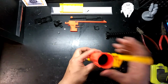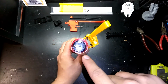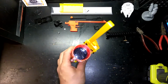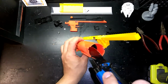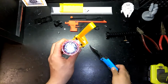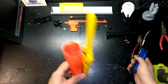Now you can see the back plate there. Hold on, let me get the lights on again. See that back plate there, and that is the air restrictor. You can see the 3 prongs that I had. Now, what I did before getting any kind of Dremel or cutting it out is I would take a knife and quite literally just start to slice into these little pegs here and cut into them, and then start taking some snips and snipping into them until they came out and the whole thing just fell out the back. Absolutely doable, but that's not what we're doing today.